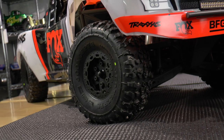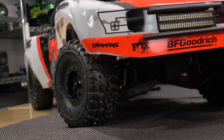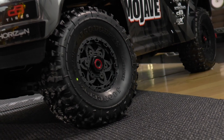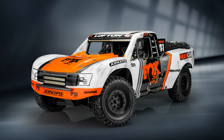What's nice about these two vehicles is they're comparable in a sense — the size, the weight — but they are built differently. We were able to use the same tire for both trucks, but we had two different wheels. The UDR has a Tremor wheel specific to that vehicle, and the Tremor wheel we made for the Mojave is a different wheel on a different offset. They use a different hub combination, with a different lock nut on the outside. The Mojave is more of an eighth-scale style with a 17mm hub, and the UDR is a more traditional Traxxas fit.